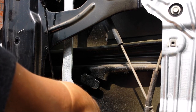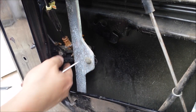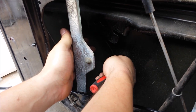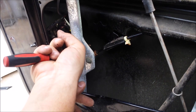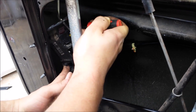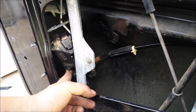Bring it towards the bottom because there is more room at the bottom — it is narrower up there and gets wider as you go down. Now to remove the electrical connector, you are going to put the flat head underneath this purple tab and pop it up.